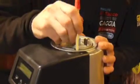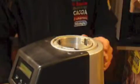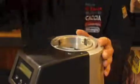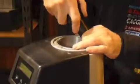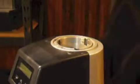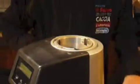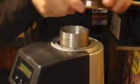Before we do, we've got to clean up the inside of the hole where the spring goes. You want the spring to sit on a good surface, nothing dirty. So loosen up whatever is in there. It might be a little grounds. Use our usual pick. And then with a vacuum, just suck all the dirt out. Once everything is nice and clean, put the 3 springs back in. Put the holder like that, just align it. And here's the final piece, the flange.